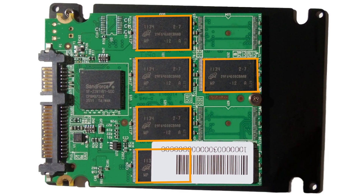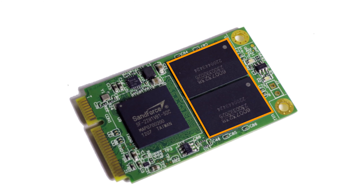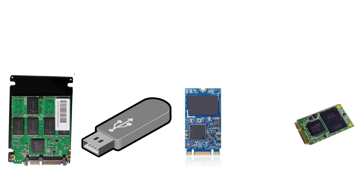We also have flash modules. In a bigger SSD like this they can be spread throughout the SSD anywhere, and in something like an mSATA drive they will generally be piled in one location. Every SSD or storage device will have flash storage because they're pretty important. Just like the controller, even something like a USB memory stick will still have a controller and some sort of flash memory, because without those two things you can't store any data. At one end we'll see the interface such as SATA, M.2, mSATA, or even USB if you're pulling apart a USB thumb drive.